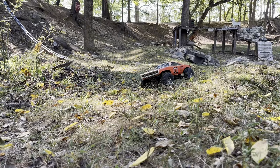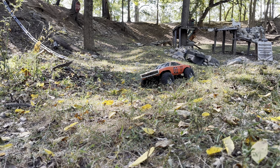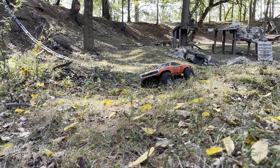Well, I think one of my plug wires got a little close to my new headers. Seems like it melted a little bit and cut the ignition. So, threw some tape on it, rerouted some wires. Hopefully they don't bounce back over and sit back on those headers again. But we should be good to go now.